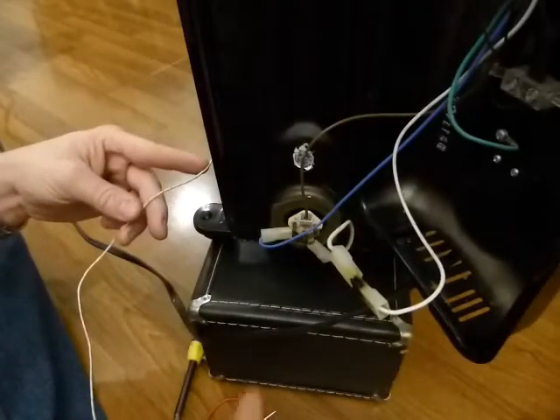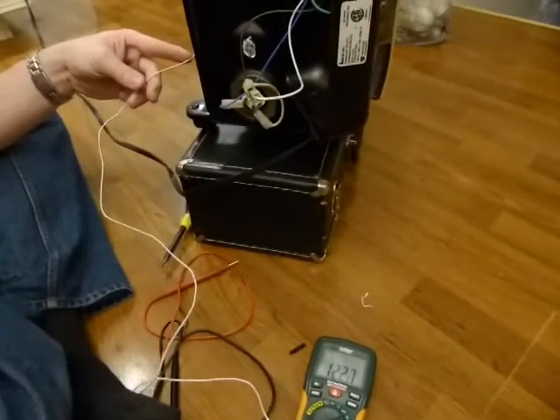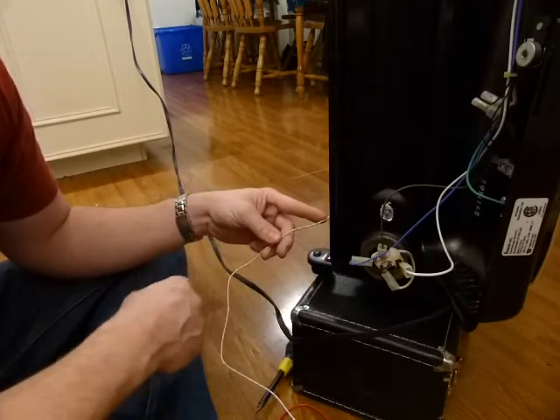Down there is where it's the hottest. The temperature on the display panel won't correspond to the actual oil temperature — I had it set to about 70 degrees on the display, but that's not really the temperature of the oil. When I look for a replacement switch I'll want something that trips off around 270°F, which is roughly 130–140°C, just in case of overheating. Either way, it's working and functional — it just needs that little switch replaced. Super simple.